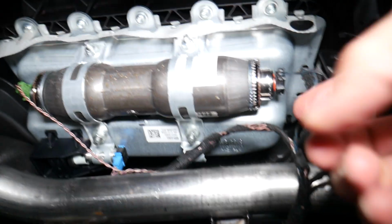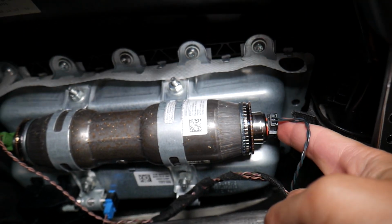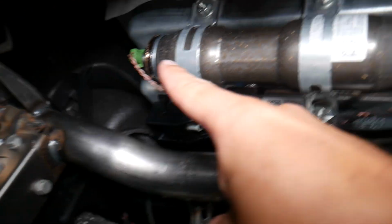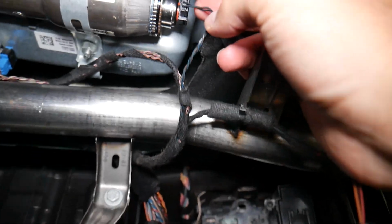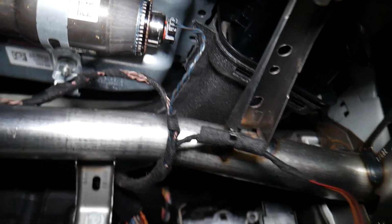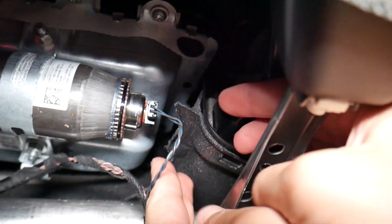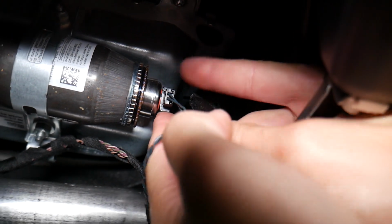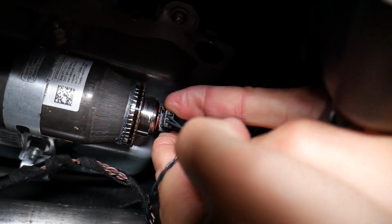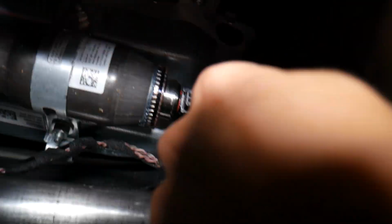And if you come right here on top, you will notice, for instance, this is the airbag for the passenger side. We have one, this is stage 1 igniter, stage 2, and that's the valve. We'll demonstrate on this one now. Let's try to hold the camera focused like this, so we can see the whole action. Okay, perfect. So that connector here, we grab that thing on top, and that connector itself, the plastic thing, will come out.